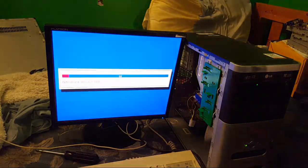I'll have to go look at that Intel board, but I'm pretty sure, if I remember right, it does not have an IDE controller on board. Which, when you think about it, is kind of bloomin' stupid. Of course, that said, I have another system that I rescued that's got an Intel board in it. I could see if that board works. And I know that one's going to be another one of those DQ35JO boards, and those do have IDE controllers on them, so I could use that. Of course, I can guarantee you that it doesn't work.